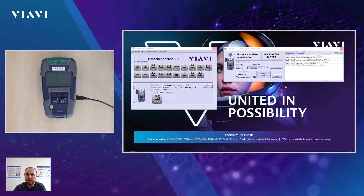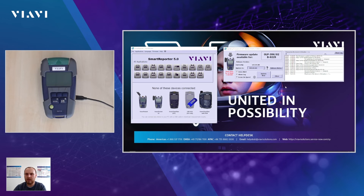The first step is to update the primer. In this case, it skips the step because it says it's not necessary — the same version is already installed. The second step is to update the bootloader, which is also skipped because it's already installed. It often depends on where you start the update from: if it's an older version, you might need to invest more time; if it's a fairly new version, there might be less time needed. There's an extra step to check if everything's still working fine. The third step is to transfer the application. The fourth step is to transfer the templates, which are needed to create jobs using the Mobile Tech App. The fifth step is an important one for the OP39, because it's transferring the FPGA files to be able to carry out data analysis.